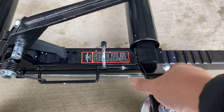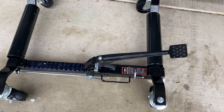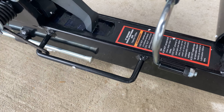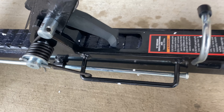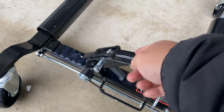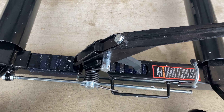We can spread this out and open it up really wide so we can get it around the tire when it's sitting on the ground. Once we have it around the tire, we step on this piece, and you can see that little arm goes in and pushes on each of the teeth, pushing them out. To start ratcheting, flip this little lever — that engages another tooth down there, so when you push down it won't allow it to open back up. Every time you ratchet it closed one notch, it stays in that position. When you're done, make sure the tooth is holding, flip this down to disengage that other tooth, and you'll be able to let the car back down.